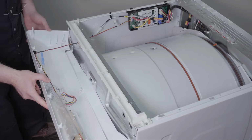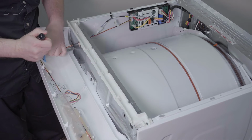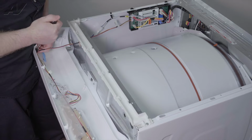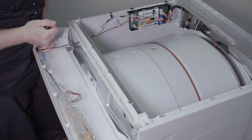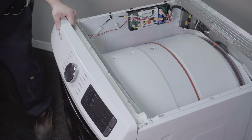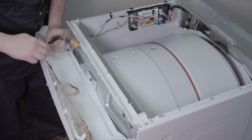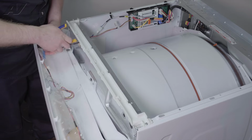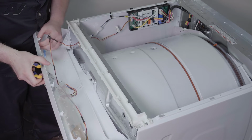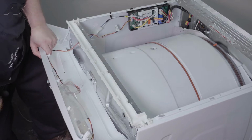The wiring goes all the way back to the console, so what we'll do first is remove the strain reliever just to give us a little bit more room. I'm going to use a tack puller, lift up on the edge, and start to take it out, but be careful as they mount it in very durable plastic, so go slow with it. Actually, I'm going to take a different route. Because of the way this is flexing, I don't want the plastic to break off, so I'm just going to cut the strain reliever off. There we go. I'll push that remaining piece through, and when I reattach it, I'll attach it with a zip tie onto the same spot.